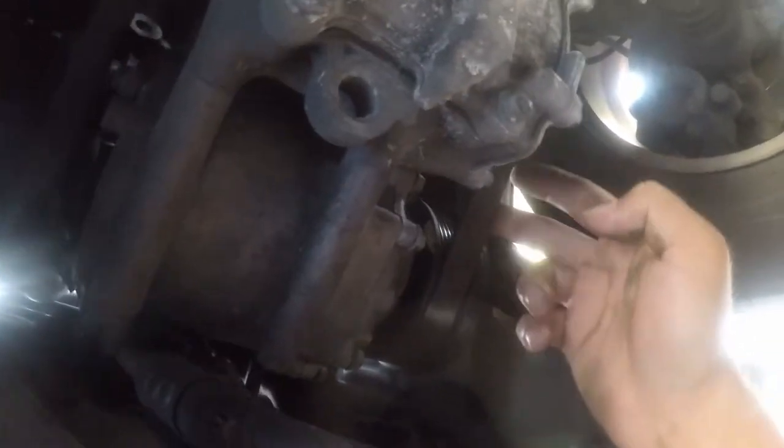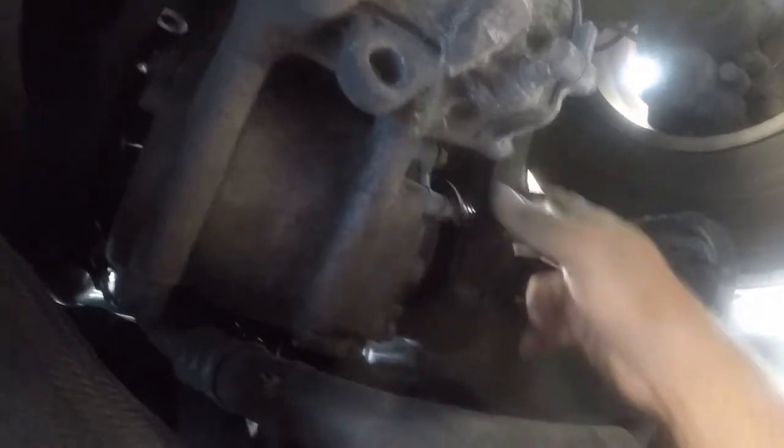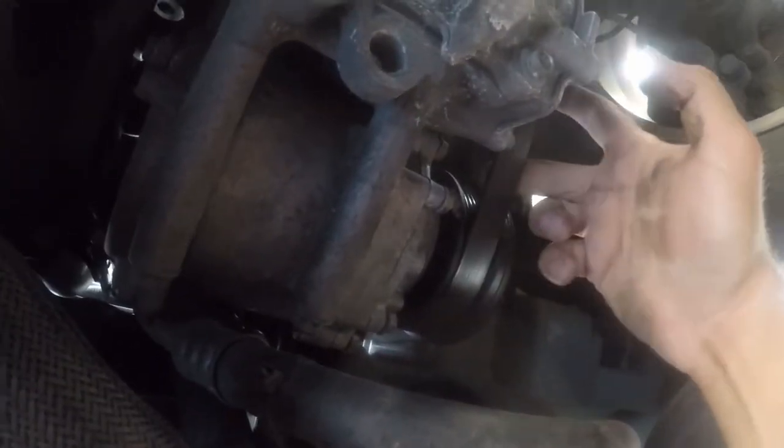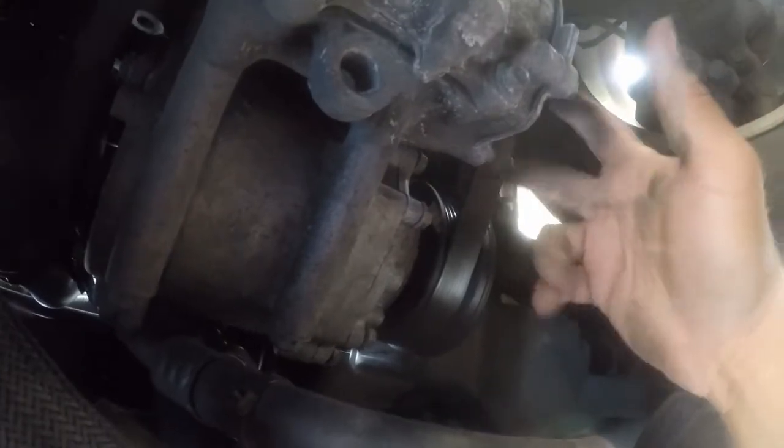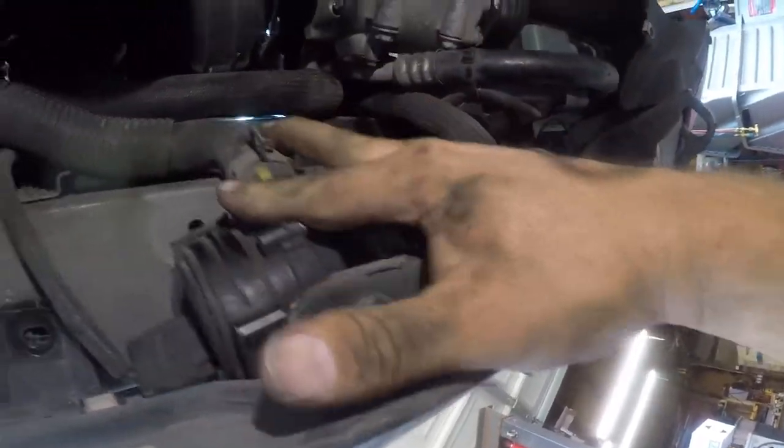There's an oil filler tube right here on the front, and there are belts. The belts are the next thing to come out, and I'm replacing this one because it has some visible wear, and I don't know how long it's been in here, so I'm putting a nice Dayco belt in. Let me get that. I used my pneumatic wrench to get the bolts loose that were in the frame so that I could push this auxiliary pump out of my way.